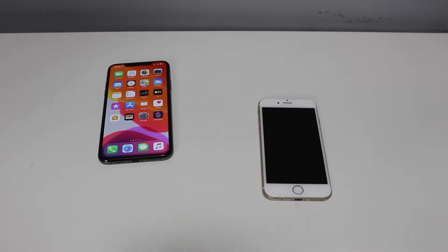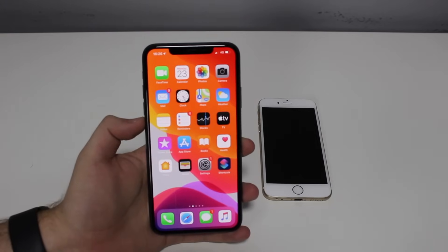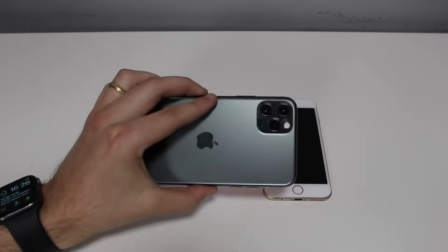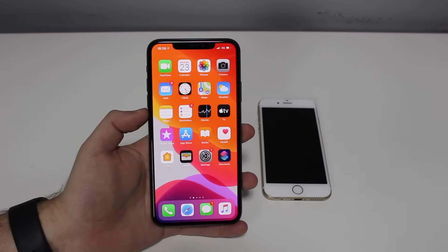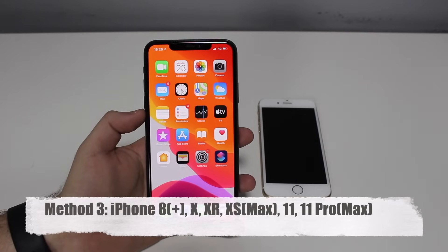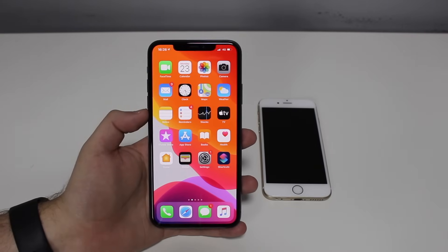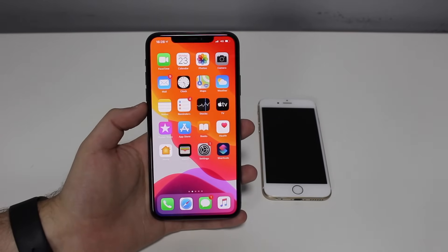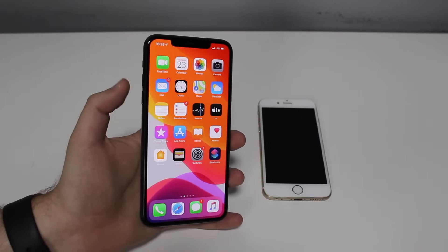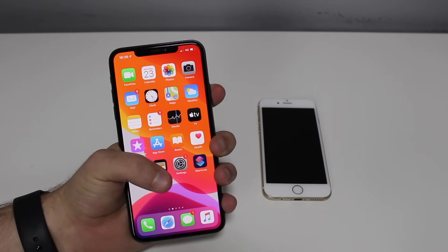This covers the process from the iPhone 1 all the way to the iPhone 7 Plus. For all the new iPhones, there's just one process. If you have an iPhone 8, 8 Plus, iPhone X, XR, XS, XS Max, iPhone 11, 11 Pro, or 11 Pro Max, it's the exact same process: press the volume up and release, press the volume down and release, then press and hold the power button — now called the side button.